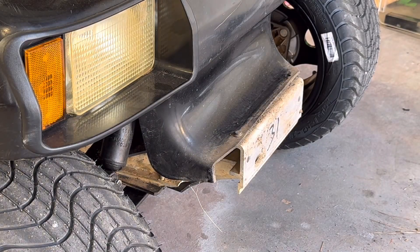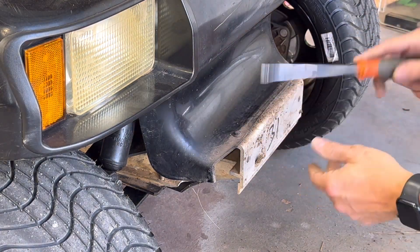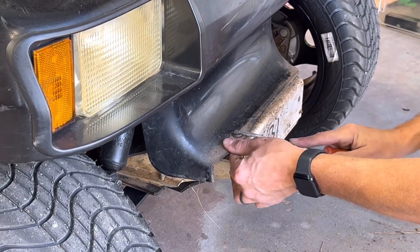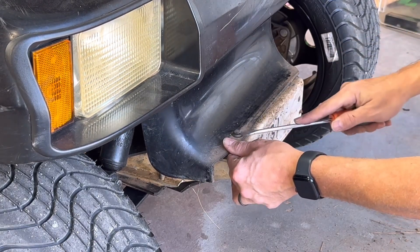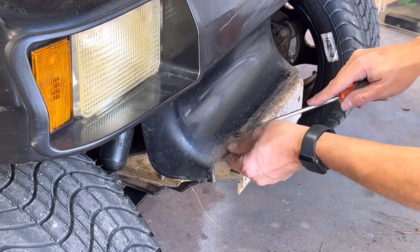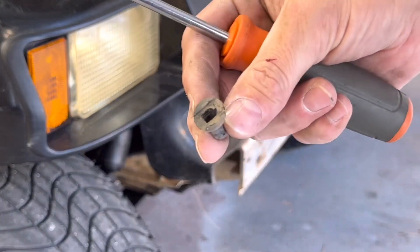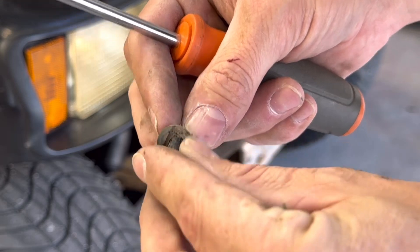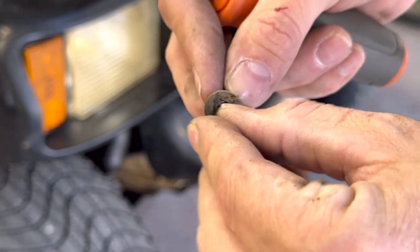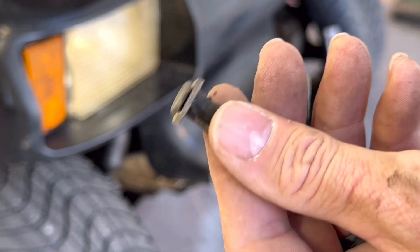On my cart it's missing one, but it's got two plastic clips in there. Take a flathead screwdriver — there's a spot to pry — and just slowly pry up and pull this middle piece out. Then this bottom piece right here will slide out as well. The way it goes together is like that, so you have to take this little piece out first, then the bottom piece will come out.